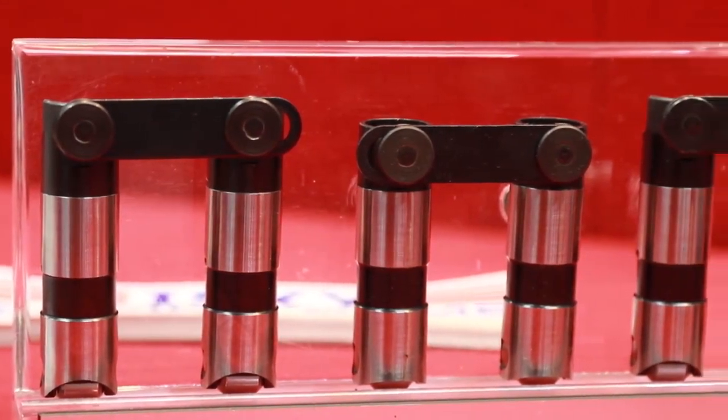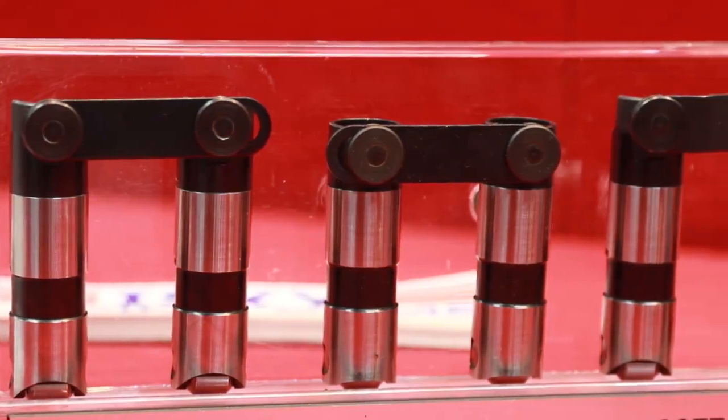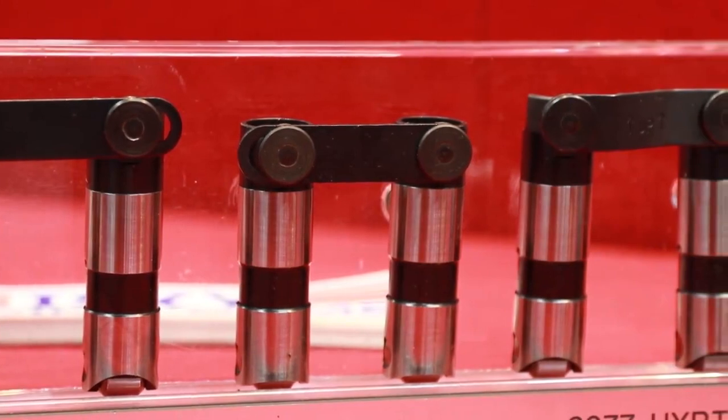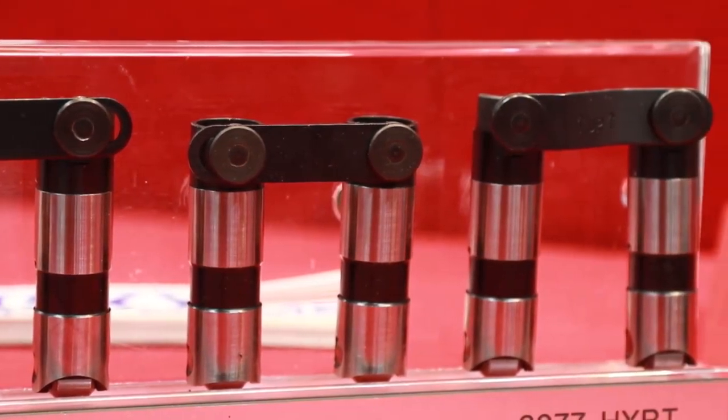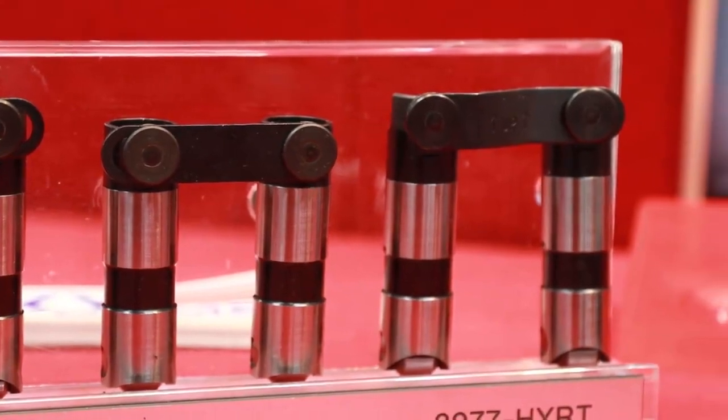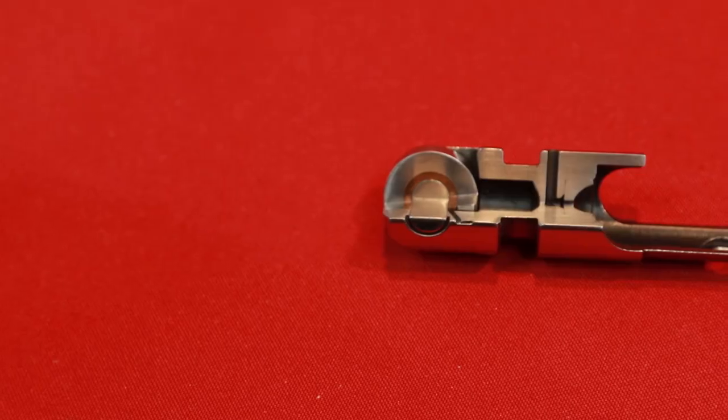Talk a little bit about the Bigfoot effect. That's one of the things a lot of people don't realize. I pick stuff up. I'm not a dummy. Typical roller needles, you're only talking about 2 or 3 of the needles actually supplying the force against the pressure that's inside the lifter. You guys have come up with something that's much more advanced. Let's talk about that. Yeah, sure.